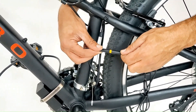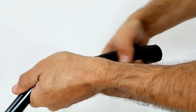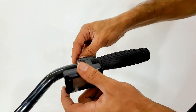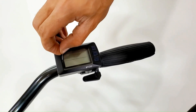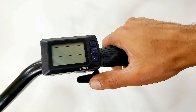Make sure to align the arrows. Do the following only if you are using the LCD wireless display instead of the throttle cable. Remove the grips, slide in the LCD wireless display, and insert the grips back on. Tighten the LCD display from the back side. Make sure your throttle moves freely.